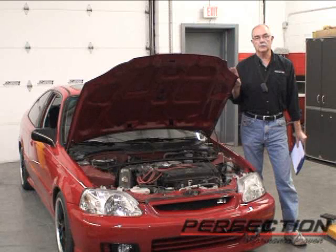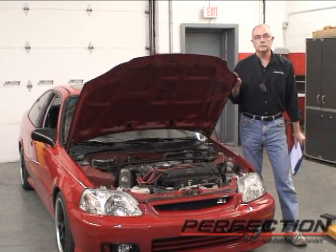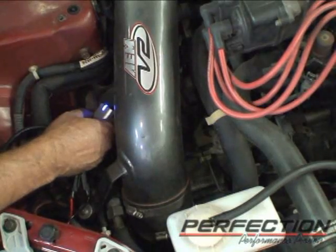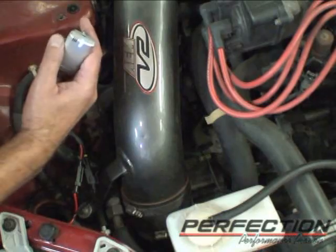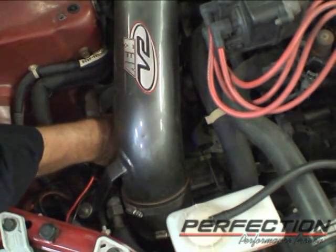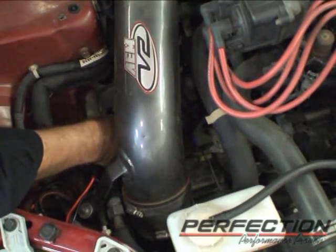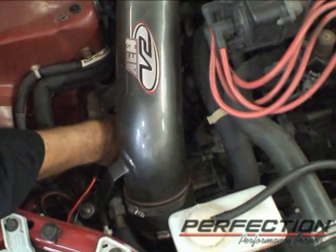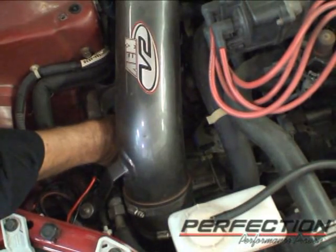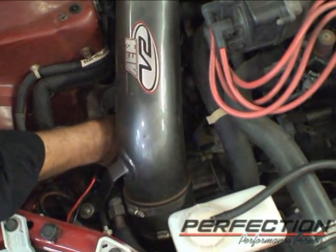Now this bearing is turning continuously, the clutch release bearing, so we're going to find out whether it's the clutch release bearing or something else. This is with the pedal up. I'm going to take the microphone and hold it down close to the transmission now. Pedal up, pedal down. Noise got quieter. Pedal up. There's our noise. Pedal down.